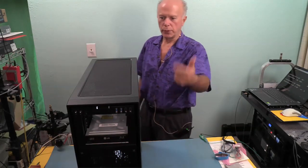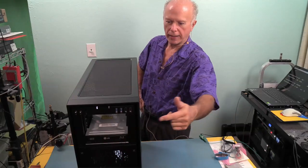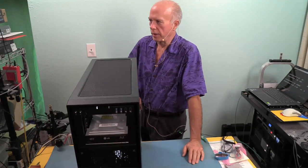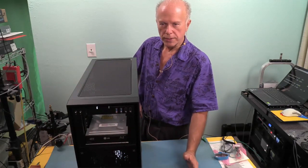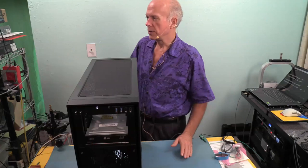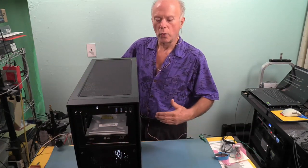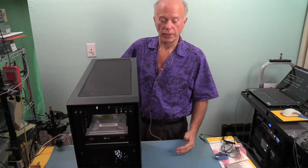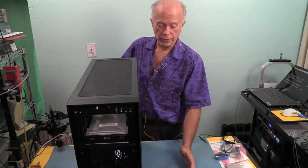Start, power, restart. Used to be in old machines that if the driver disk was left in during this operation, the system would sit and hang trying to install the operating system from it. The install routine has gotten smarter and it doesn't do that anymore. We've come from an 8350 to a Ryzen second generation to a Threadripper 2, which was a second generation Threadripper, to now a Threadripper 3. We're going to do some activities where we show you and compare the differences in how those machines operate.